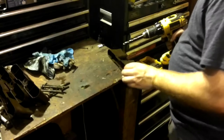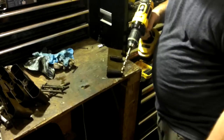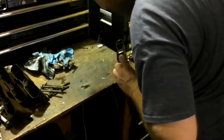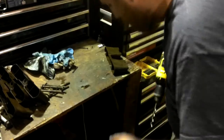You know how RBs have really shitty oil drain issues, and you have to run an external drain? For an LS, you just drill a couple of holes in some plastic. So that's what I'm gonna do. Come with me on this magical adventure. You gotta do one in each side. They recommend half inch, but I only have a 3/8 bit, so that's what we're going for. The good news is, if I fuck this up, there's spares in the other motor.